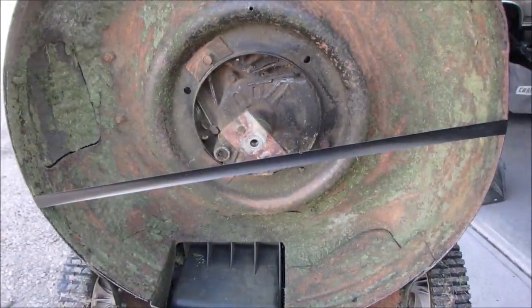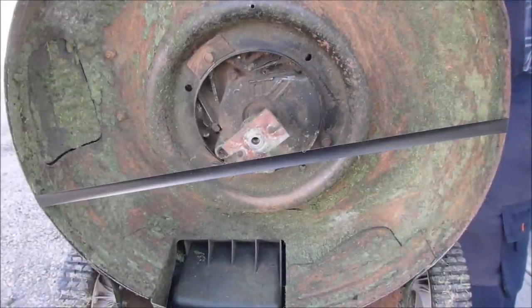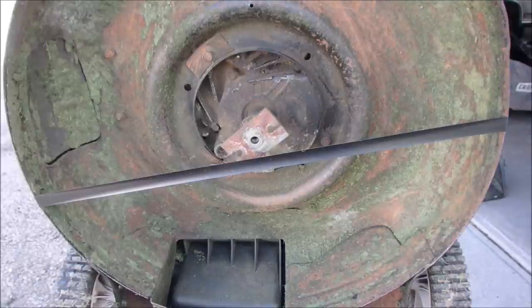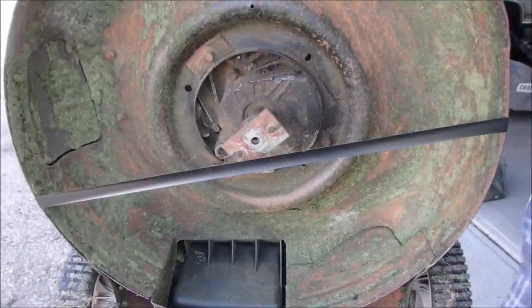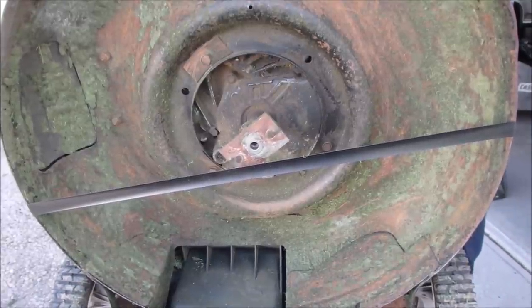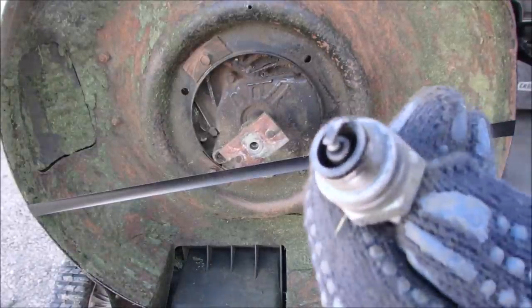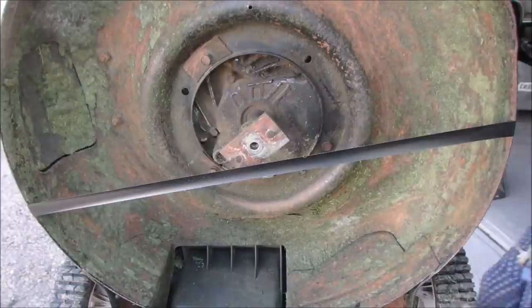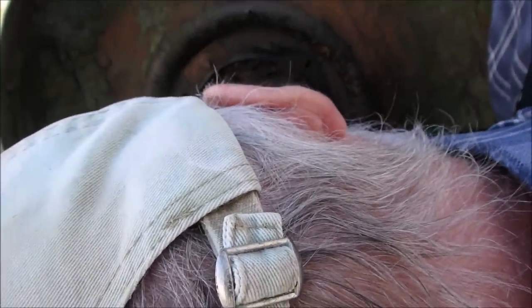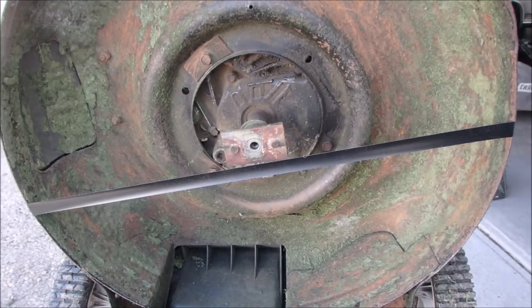Now, unfortunately for you, I gotta turn the motor over. The spark plug is, well, let's take the plug out. It's got an RCJ8 in it. Should be an RJ19LM, right? On an old Briggs Quantum. We'll have a look at it together. That's the wrong plug, but it does thread in. Okay, so now we're going to do it straight this way. I'm in the way. No, there's nothing wrong with that crankshaft. So let's go check the blade.